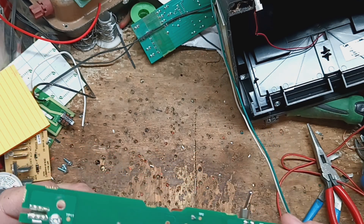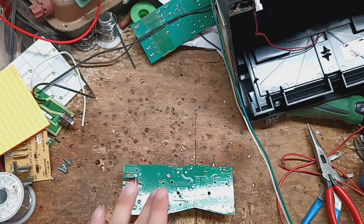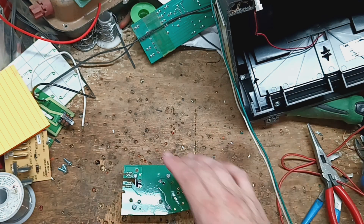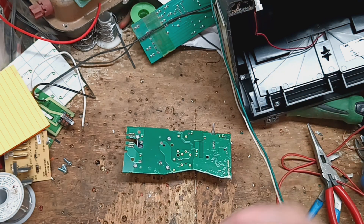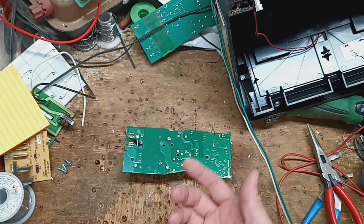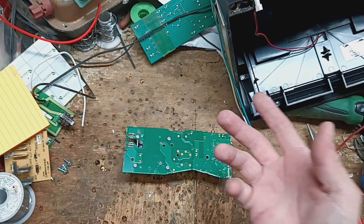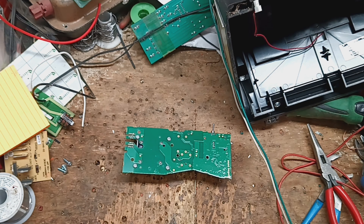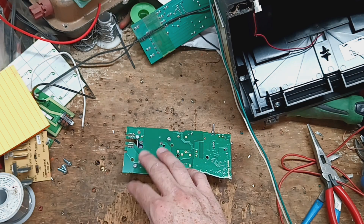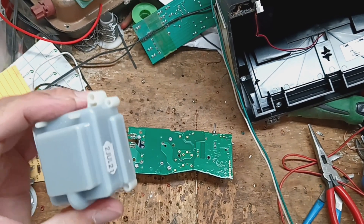Since it does click and it does flash, I want to change the transformer first. If that fixes it, that's a pretty cheap fix. The only other fix we can do is install a brand new board, which is not cheap — but it's not as expensive as a new unit. The new model today is called the S20 and they're about $250 to $265, so even putting a new board in is still cheaper than buying a new one. My solder iron is heating up — we're at 750 degrees Fahrenheit — so let me go grab a transformer.